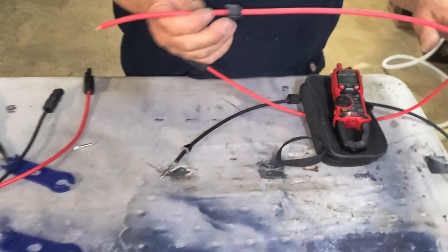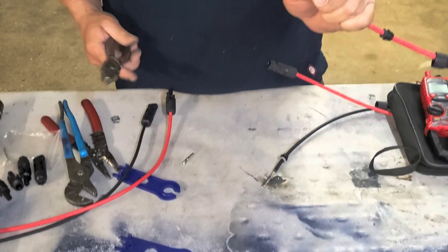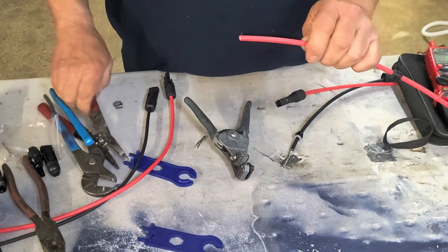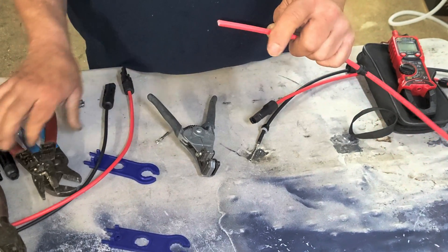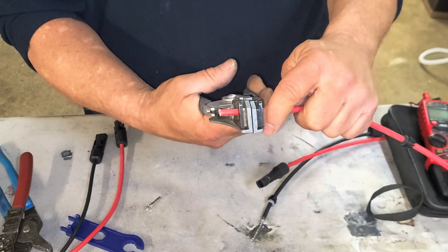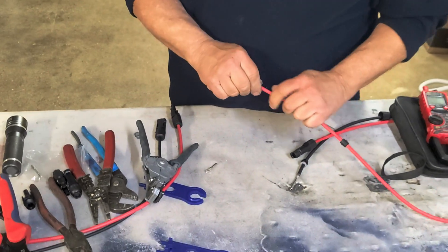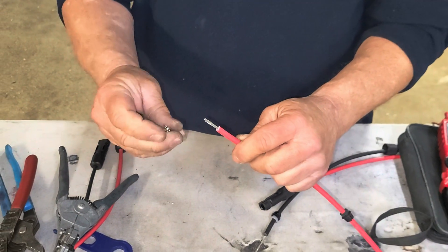To properly put on the connector, start with a clean cut edge — not a ragged one. Using lineman pliers on this 10-gauge wire for a clean cut. If you don't have an auto stripper, a pair of terminal pliers with a number-10 notch will strip it just fine. Strip off about three-quarters of an inch, twist the wire so it doesn't come apart on you, then slide on the nut and rubber seal piece — this is going to be a female end, so it takes a male pin.